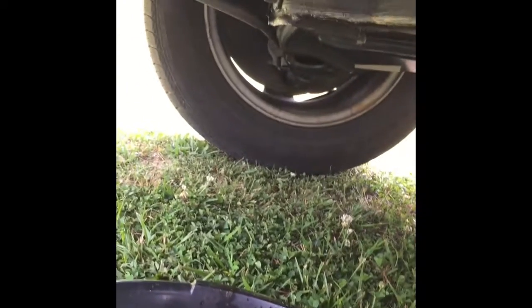But first step you're going to need to do is drain the oil. So you take your 13mm screw head or whatever you want to use, socket, and take that off, which I've already done on mine already. Dropped it down in there, which is okay. I got a new kit and everything for that. Make sure you catch your oil, put that off to the side.